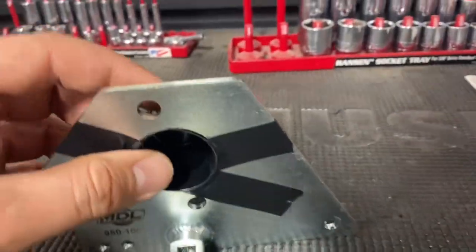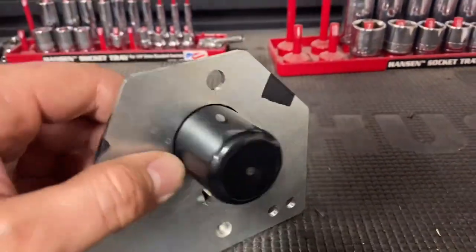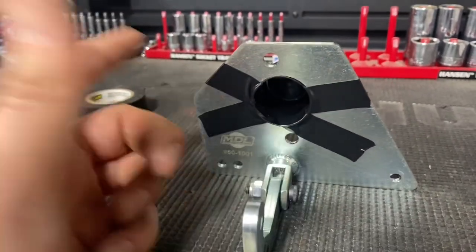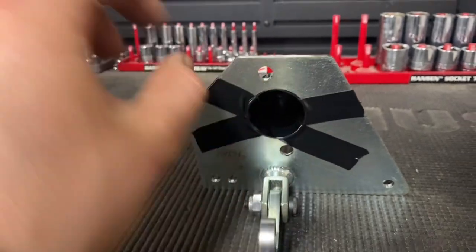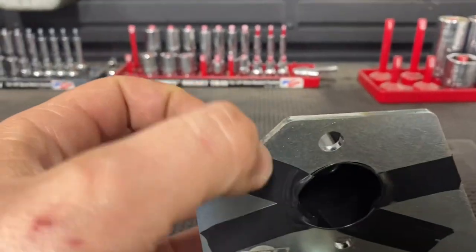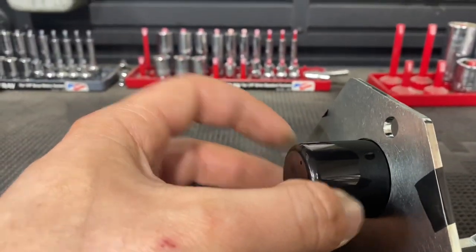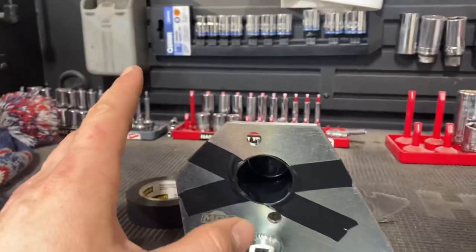Here's a little idea: this is just a top to a butane refill and it fits through the hole perfectly. They want this to butt up against the top of the pedal assembly — if you let it hang down it's going to hit the steering column. You have to lift it up and get the inner radius to mesh with the cutout you made when removing the gasket. If I tape this in place to simulate the master cylinder, I can shove it up in there, make sure it fits, then mark everything.